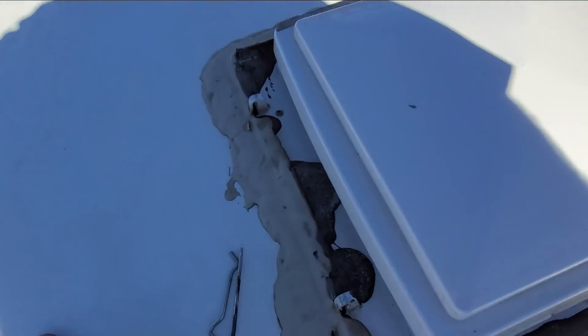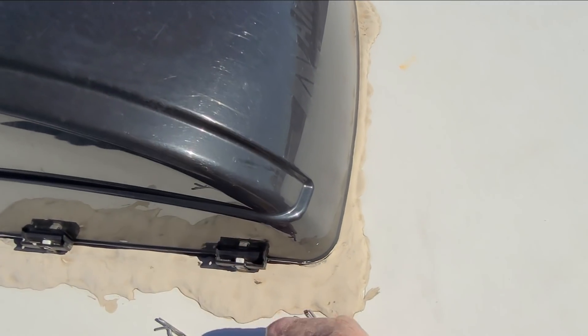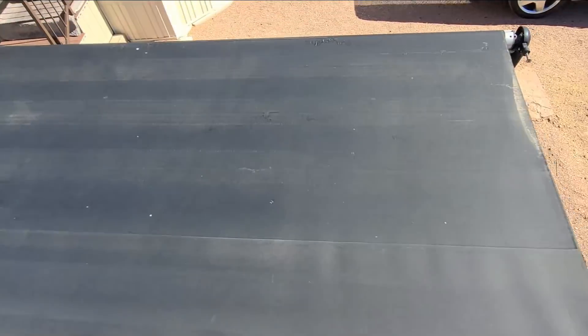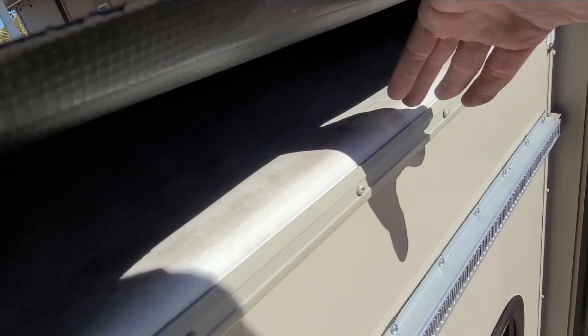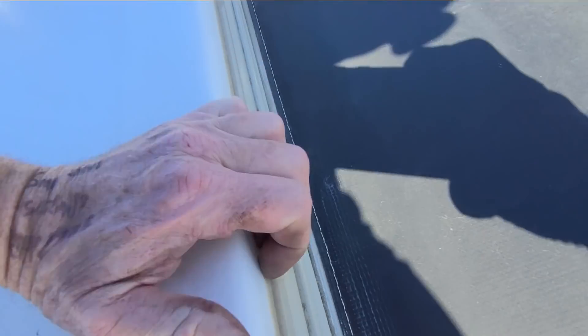So I'll take this off. Well, it's ugly underneath there, but it looks intact. That's why it's nice to have these pinned ones — if you're not going to get a vent with a built-in cover, that way you can get those covers off pretty easily, unlike bolts that never come off. This slide-out topper looks intact, we're looking good there. On top of the slide-out, the roof being a little loose is fine, there's nothing wrong with that. This sealant on the edge cap feels a lot more like a pro seal, less like a silicone sealant.